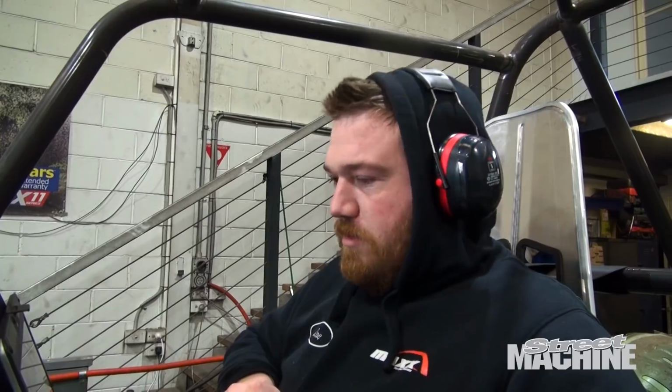So Zane, what's your initial thoughts? Pretty good. Yeah. 280 at 16 pound with no timing, and only at 4,500 RPM. Yeah, still got to take it out. It'll probably peak at like 53. Really? Okay, I thought you might go higher than that. It'll rev higher than that, but power will sort of peak and fall back. Still 284 kilowatts and we've only just begun.